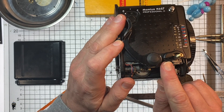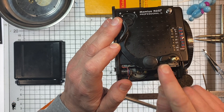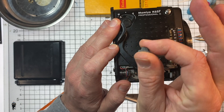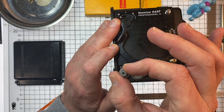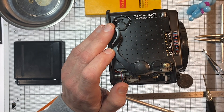There is the offending wheel. In the case of this camera, one of the teeth has broken off, so I'm going to be replacing it with a 3D printed gear — there it is, beautiful. The link to download the 3D file for this gear I'll post below. Now let's take off the top cover, which is five body screws.